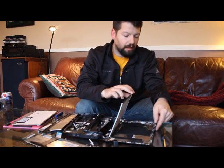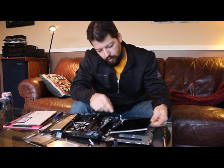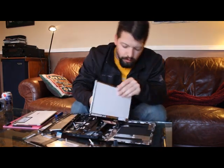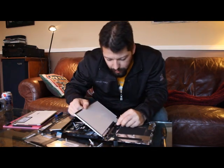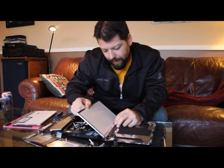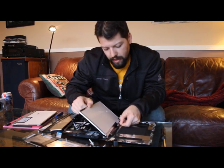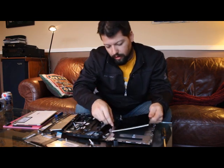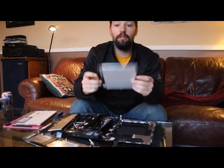This is the back or outer case of the laptop, and we've got a plug here on the hinge side that I'm going to unplug. Now, looks like there's a piece of tape that also holds this on, so you're going to probably want to peel that back. And since my screen is toast, I'm not too concerned with messing with it. But there you go. Screen is off.